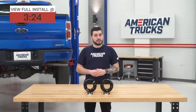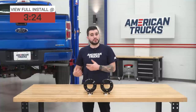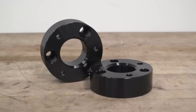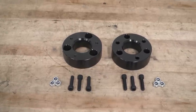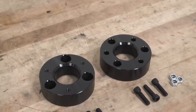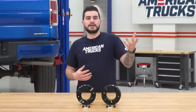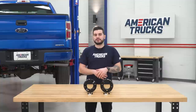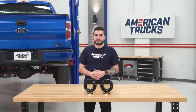From the factory, these F-150s come with what's known as factory rake — that means the front end is a little bit lower than the rear. That is specifically there for towing and hauling applications; if you have added weight at the rear end, your truck doesn't have excessive squatting. Some guys don't like the look of factory rake. A leveling kit will level the front out, bringing it up to match the rear height, making for a more aggressive and all-around better-looking truck in most people's opinion.